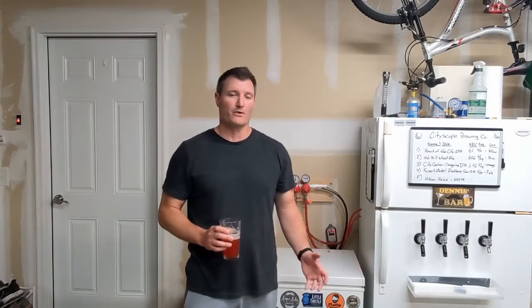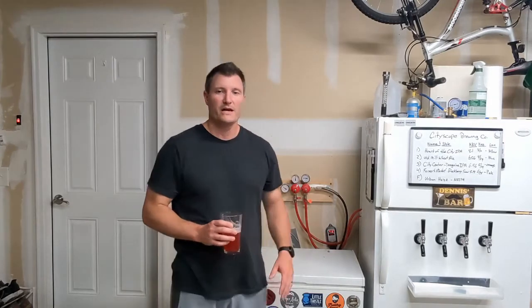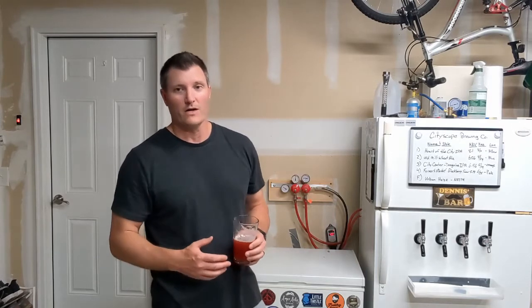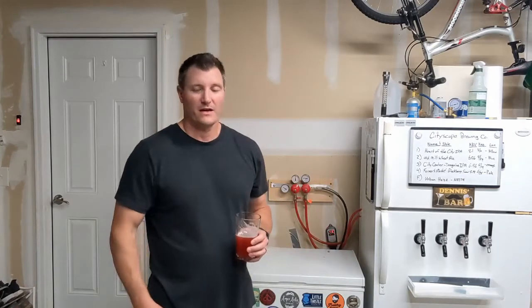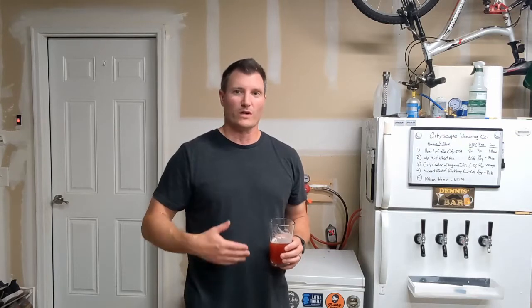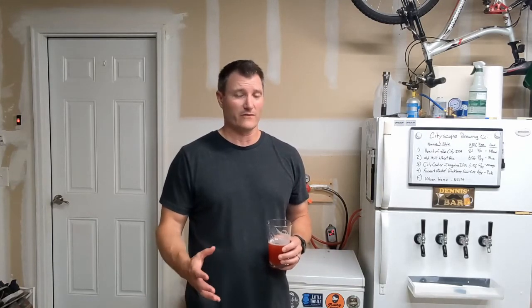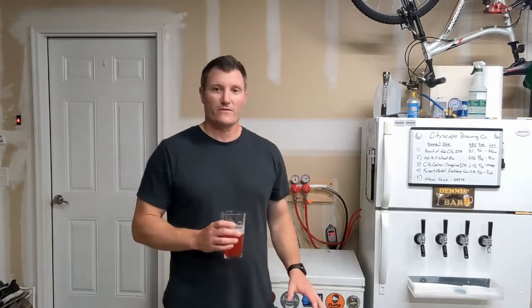Those are the few simple things you need to get a fermentation chamber up and running. I also like to keep it running even when I'm not fermenting, because the coils and compressor can dry out and cause the coils to leak over time. If it's always working a little — even at a higher temperature, kicking on occasionally — it keeps the system moving and prevents the O-rings from drying out. I've heard others have issues with letting it sit for months, and it doesn't hold refrigerant as long, so I definitely recommend leaving it plugged in.